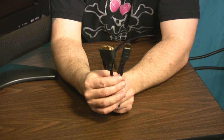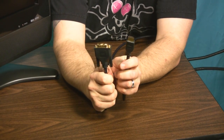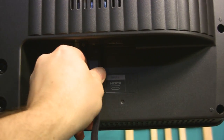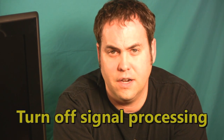Your second option for cabling is to get a cable that already has the appropriate ends on each end — an HDMI connection on one end and a DVI connection on the other. You can simply plug the HDMI into the HDMI slot in the back of your television, and the DVI end connects to your video card. You need to make sure that if your TV has any sort of noise reduction filtering, that you turn it off wherever possible, because text coming through your computer will be much harder to read if that kind of processing is applied.